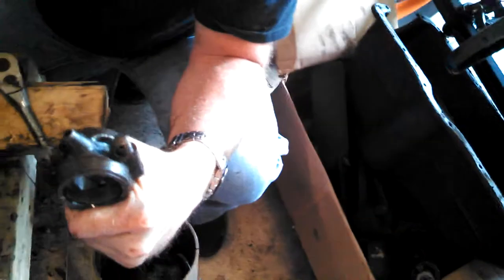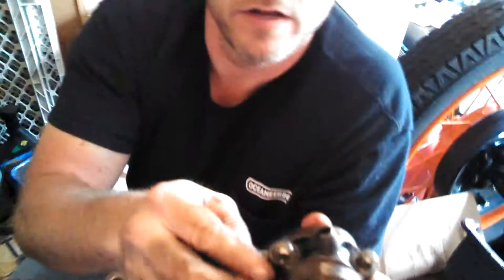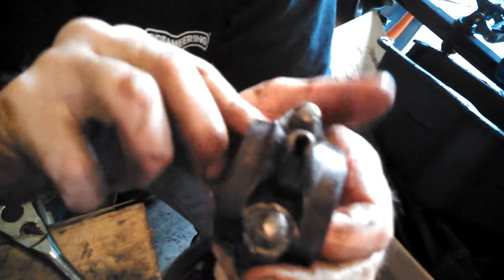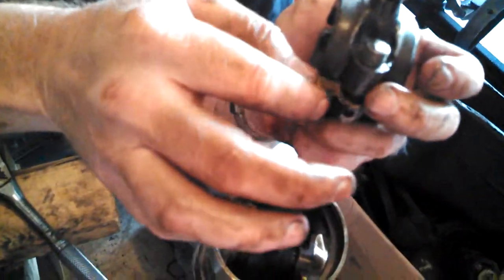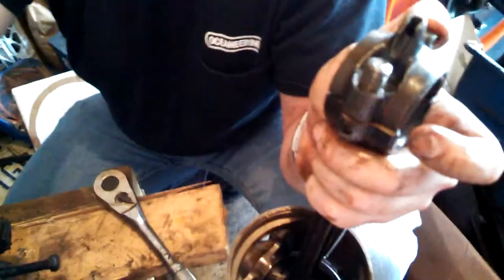These shims go right in there — a real skinny piece of metal. After a while they start to get worn out. They're soft metal compared to what the crank's made of, so these wear out while the crank doesn't — then you hear it start to rattle. With old engines you could pull the shims out and re-tighten them and it wouldn't rattle anymore. But when it starts rattling again, then you had to do a full rebuild. That's enough for now — say bye!